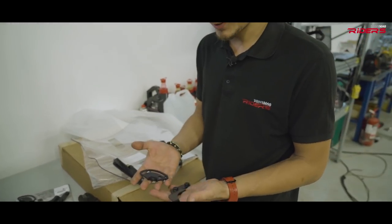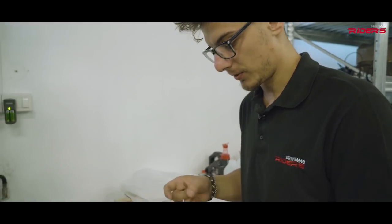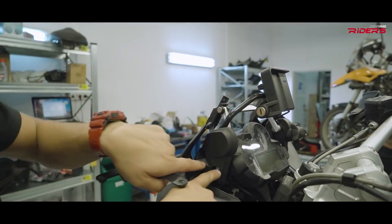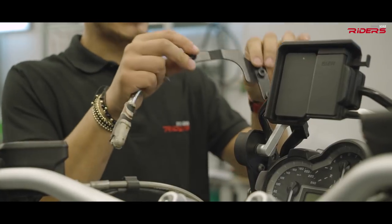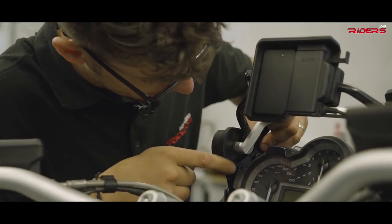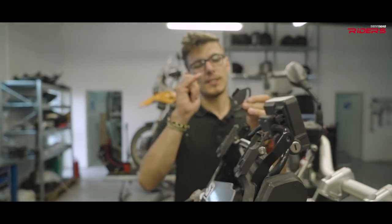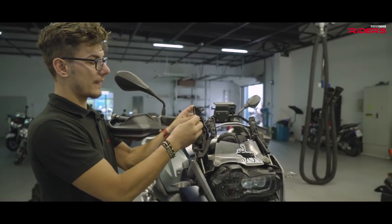The first part is done. Now I need to fit the additional holding points for the larger windshield. I have this kit that I have to fit on the bike — it's very easy to do. I have to remove this small fairing and then there are two bolts that need to be connected to the part. I'll slide the metal bracket in place with great care so I won't damage the windshield lifting system and then bolt it on. This other half will be fitted on the top of the windshield mounting point and it also comes with two plastic shims that need to be fitted.